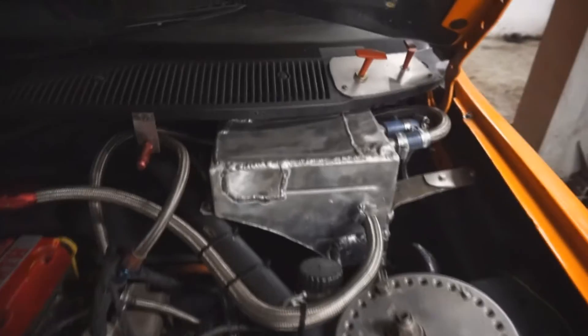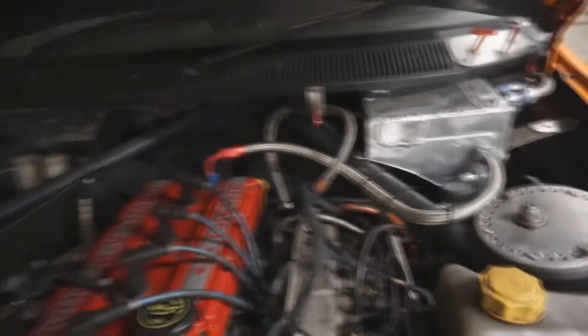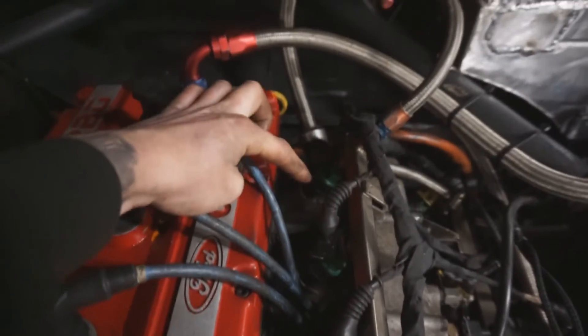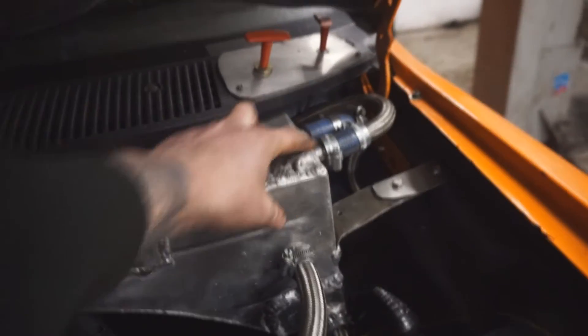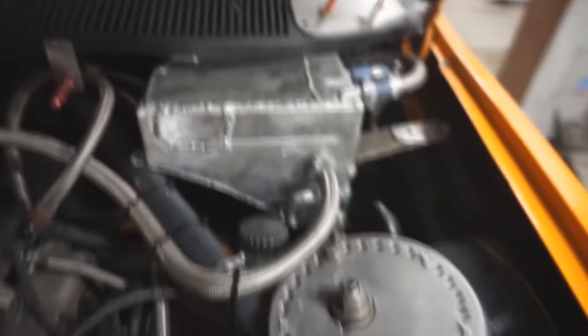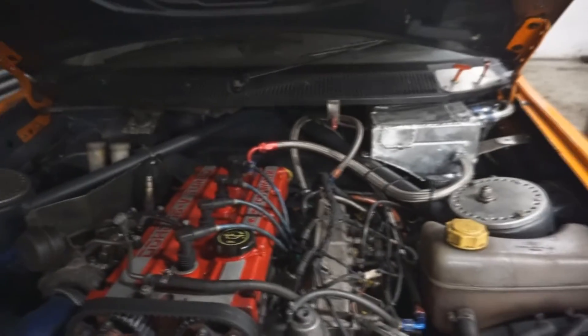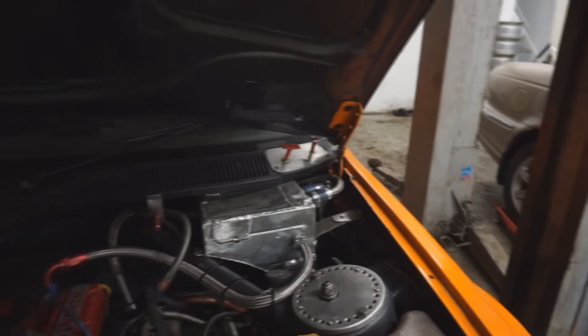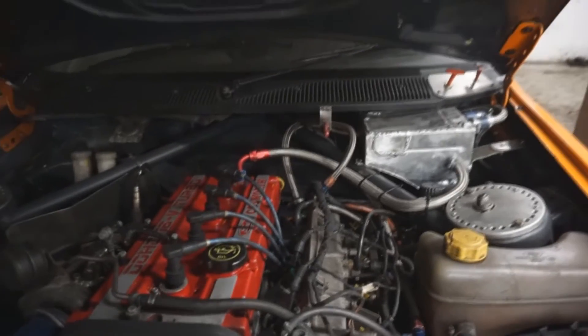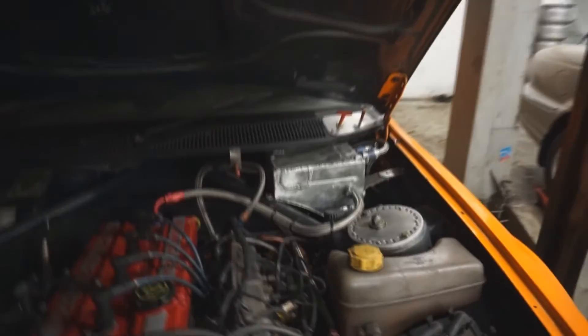I just need to tighten up my jubilee clips but it's as simple as that to go in. Basically I've got my rocker cover breather going into the top, and instead of having a standard kidney box I've got the WRC one on the side, so it comes round and up into the top. I've got one bleeding off into a catch can on the side, and then there's another one at the bottom that returns to sump - so basically everything that breathes out should return back to the sump when I turn it off, unless it fills and then it goes out to the catch can. I've also just noticed I'm needing a water pump belt, but that's not the end of the world.